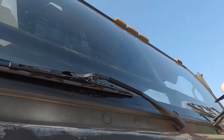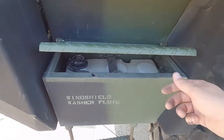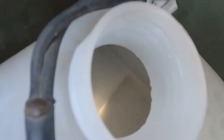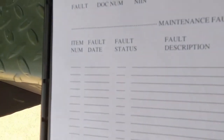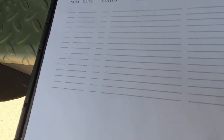We could even turn on the truck, spray some windshield washer fluid on it, and see how it clears. The windshield washer reservoir on the M1083 is right here on the side — it's marked. We can lift this up, take the cap off, and as we look down in here this thing needs some windshield washer fluid for sure. So we identified an issue — what we'd call a fault. There are two categories: undocumented and documented. This is undocumented because instead of writing it on my DA Form 5988 Echo, this is something required of me as the operator. I'll go to the maintenance bay, ask for blue windshield washer fluid — it's the dilute kind — so I'll put 50% of the blue fluid in and then another 50% water. That first problem is solved. I went ahead and added it. We still do not have any faults to annotate. We're good to go — on to the next.